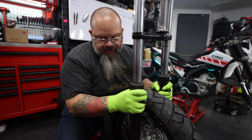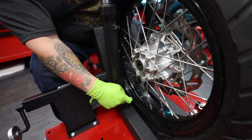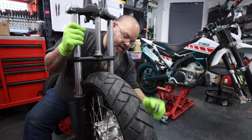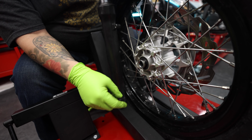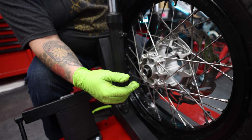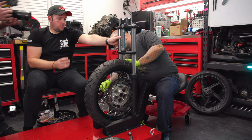Judd is going to make us spacers. He's going to make us spacers to go in between here and here. There's always a spacer. These are the ones for the WR. There's one for the left side, and one for the right side. They hang inside that rubber seal. They kind of just hang out where they're at. The rubber seal keeps dirt from going in. The spacer keeps the spacing right, and a greased axle going through will keep all the water and debris from getting through. So he's going to make us new ones of these.